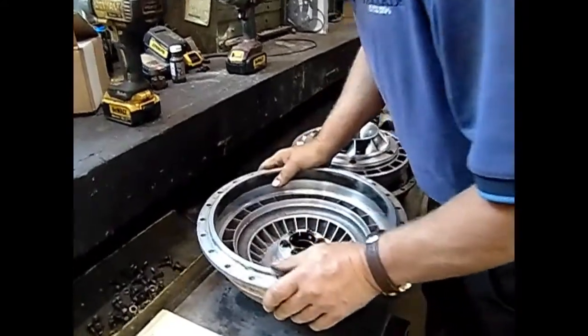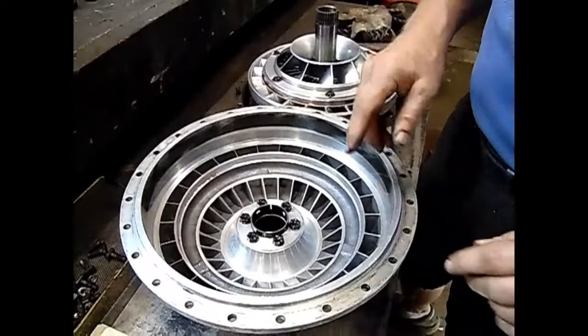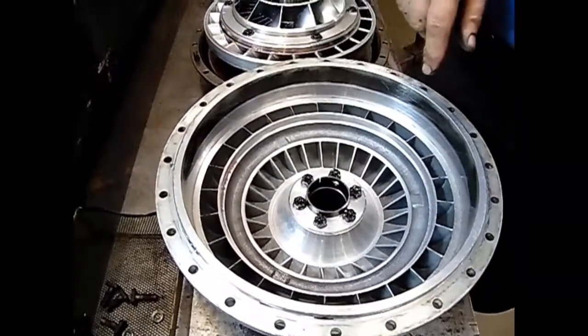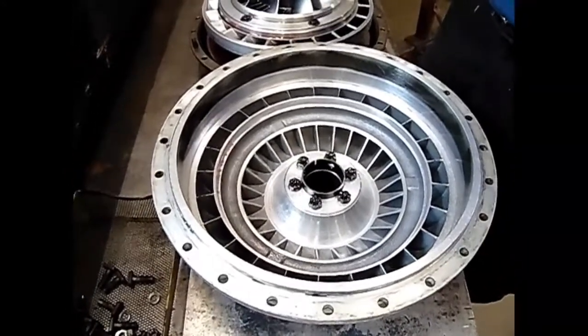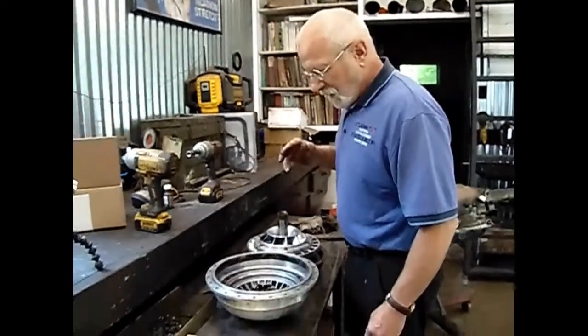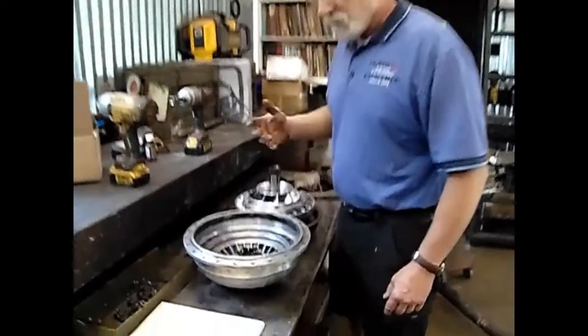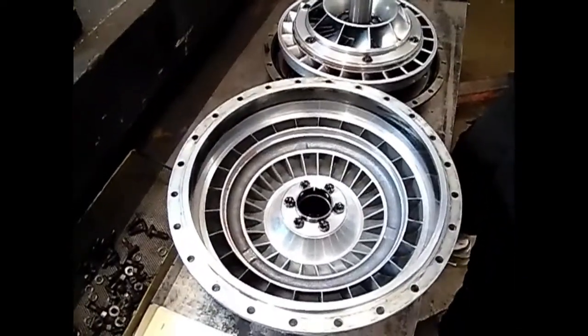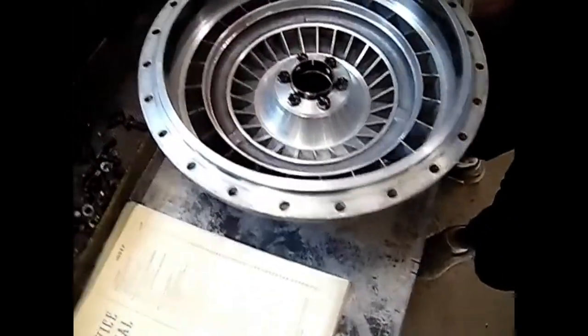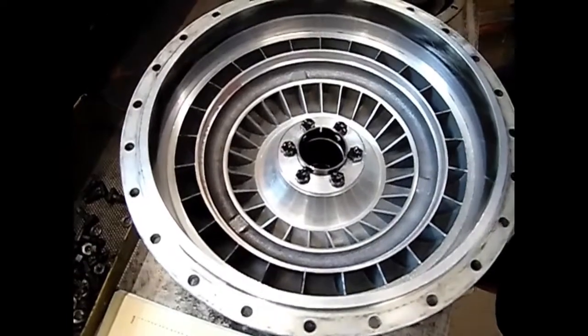This converter seems to be in very nice shape. Oftentimes if there have been problems, the vanes will be broken up. These vanes are in wonderful condition, because if anything comes loose inside — a bolt or something of that sort — the oil is traveling at 400 miles an hour when you accelerate away from a stop, so it doesn't take much to really ruin something. Because this is a Patrician, they offered two different torque converters in 1956. These vanes are almost straight like the sections of a grapefruit. The two-door hardtops and the Caribbean had vanes set at an angle, giving the torque converter a little more performance off the line — it's quite noticeable, and a very nice upgrade for any '56 Packard.